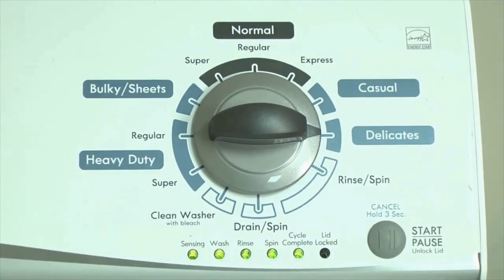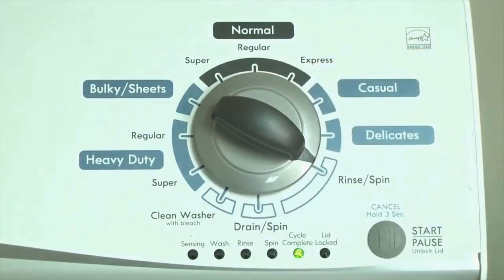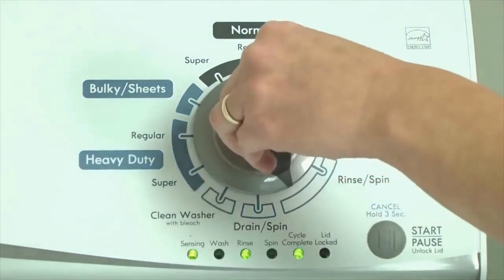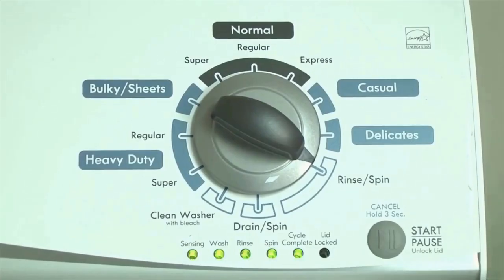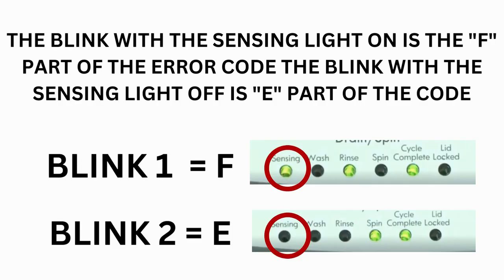All the green status lights blink when you successfully activate the diagnostic mode. If the status lights don't blink, try again and maybe try turning the knob a little faster or slower. Congratulations — now your washer is in diagnostic mode. Now we need to retrieve the codes. Follow these steps to display the error code lights. Step 2: Turn the control dial 1 click clockwise, then press the start button. Now you are reading the error codes. Turn the control dial 1 click clockwise to display the first saved error code. Just the sensing light flashes if no error code was recorded. If this is happening but there is still an issue, you will need to watch our other video.